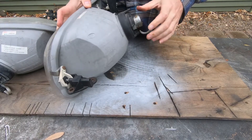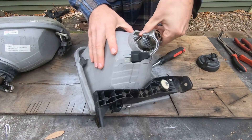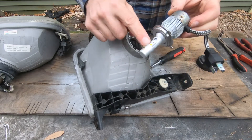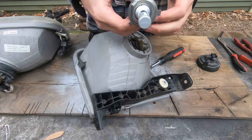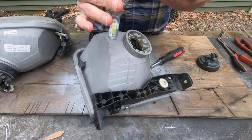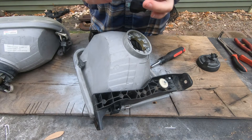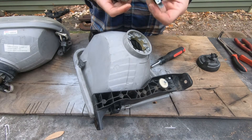So I'm gonna pop those out. These are the bulbs I was running — they have this little cover on half the light that's supposed to give you a cutoff on the beam, but it doesn't really work. The light is still pretty bad. These are standard LED bulbs with a built-in cooling fan, and I believe one of them stopped working at some point. I think that's the reason the light went out — it probably got too hot.